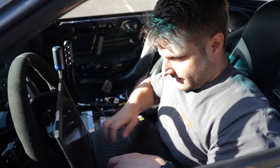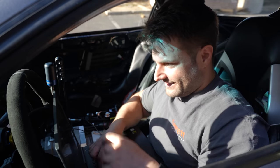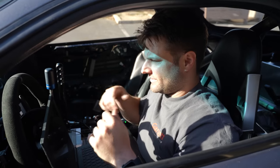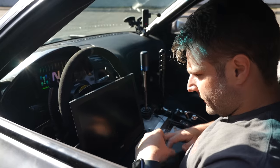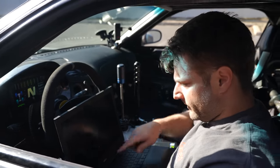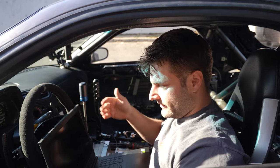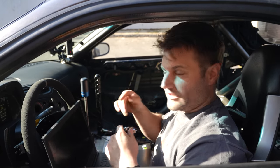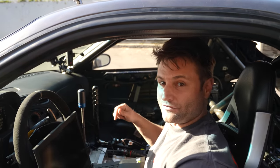Wants to see if there's a difference between the wheel speed sensors now, but it's neat because I can see the speedometer matching the GPS speedometer, within a mile an hour, it doesn't really matter. I am going to take it for another loop, but I'm going to be watching each of the four wheel speed sensors to see what effect they have on each other, and then we will look together on the logs as I'm turning to see if we can see wheel speed differences in the front two tires.